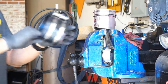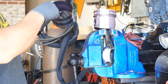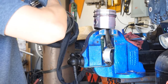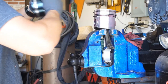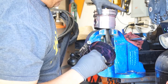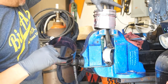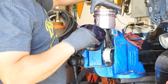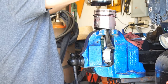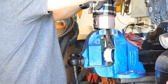I need to get a new ring compressor because this ring compressor sucks. What I found out is I just have to use a lot of lube. Make sure you line up your rings — I have the oil ring on the skirt, and then the compression rings where the wrist pins are. You don't exactly have to have them on the wrist pin, but that's where I have them.